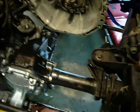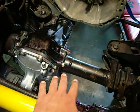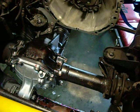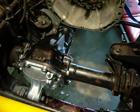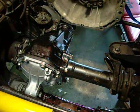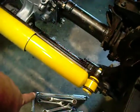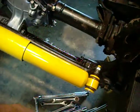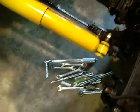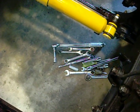Just to let everybody know real quick, if you're thinking about doing this or nervous, it's not a big deal, but you've got to have all your tools ready. You need at least one, possibly two, 17mm open/closed end wrenches. 19mm same thing. Sockets — 19 and 17, long and short, half-inch and three-eighths — because some areas of the spindle are just a little tighter to get into.